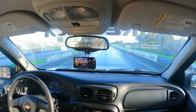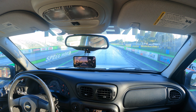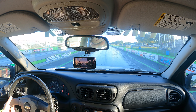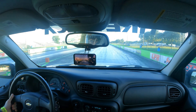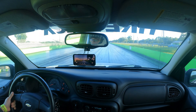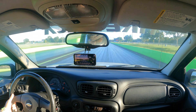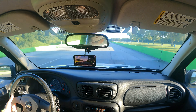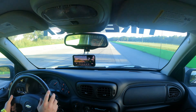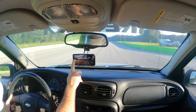Now that being said, with my after runs being just regular water, driving it to the track, no ice in the tank, and having within hundredths of a second of the same time I ran with ice, I think we can logically deduce that the electric fan picks up roughly 14 horsepower that's equatable to the track. Unfortunately I understand it is probably not the direct one-for-one comparison that you would like to see, and it's really not the one-for-one that I wanted to provide. However, that is what I had to do with the time that I had to work with.